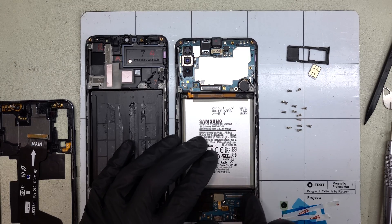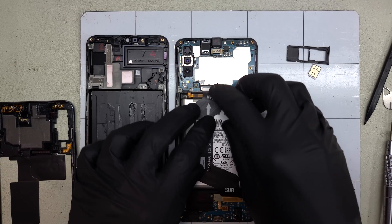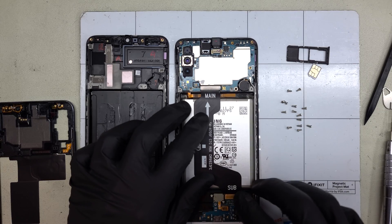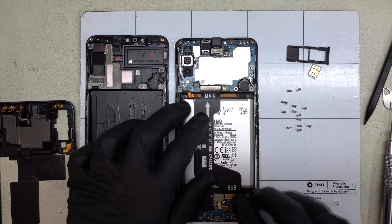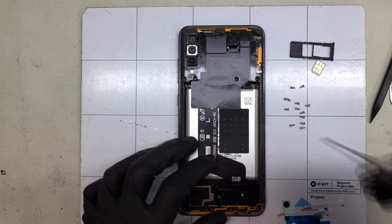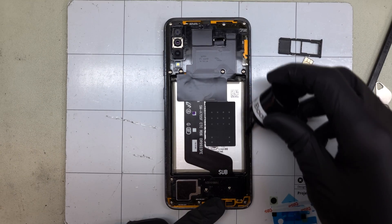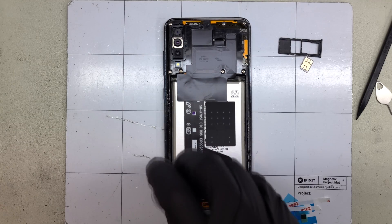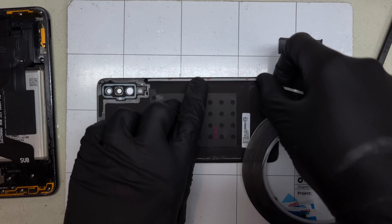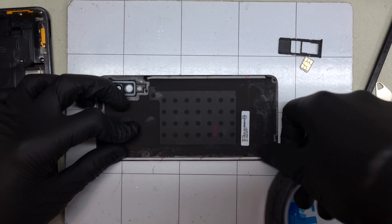Finally, connecting the digitizer and OLED to the daughter board and reinstalling the main sub ribbon connector. After reconnecting the battery, it's time to reinstall the mid frame — it clips back into place, though not as satisfyingly as removing it was. Now we have 14 screws to replace. I'll coat the edges in tape primer for a good bond. The back panel lost a good amount of its adhesive in the removal process — I'll replace the critical areas, but unfortunately there won't be any water or dust resistance to this device.